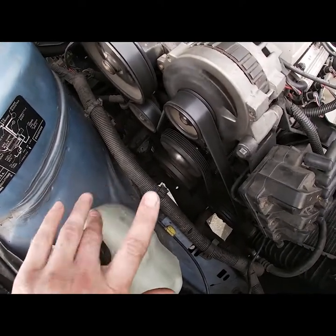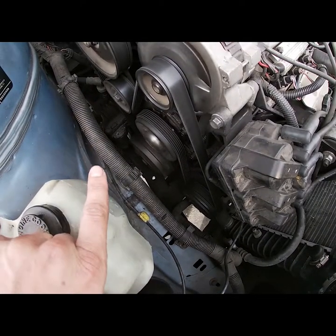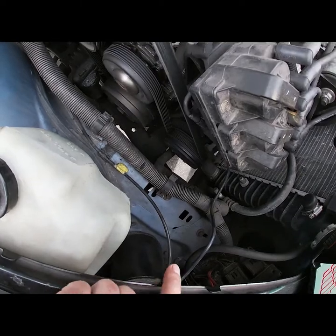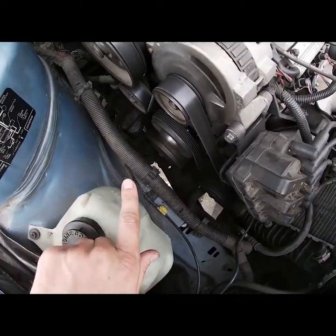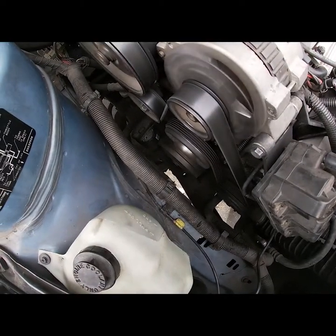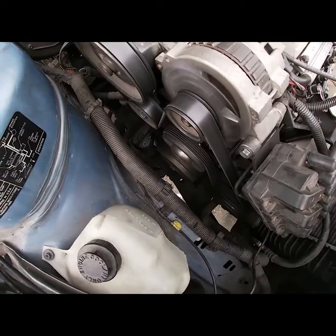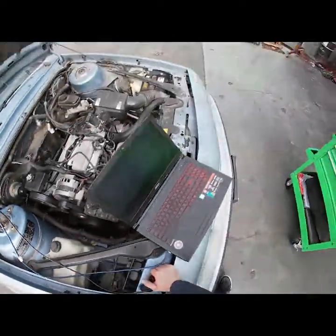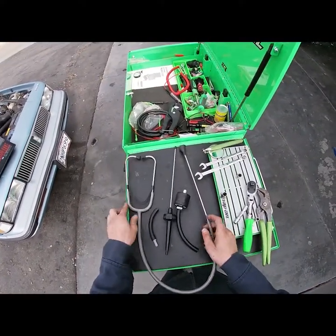So you can hear the noise, it's intermittent with the compressor off. Picking up. Once the compressor engages, it's pretty much way more consistent. See, the compressor is shut off, it gets a little quiet. So, belt noise. These are the tools we usually use to find those.